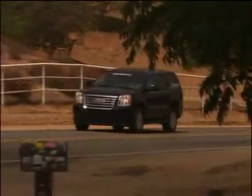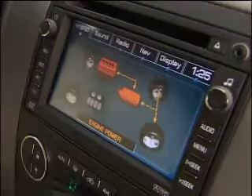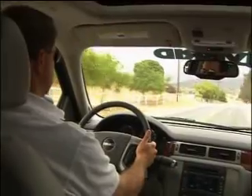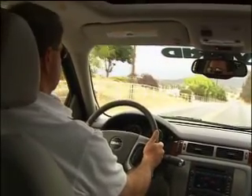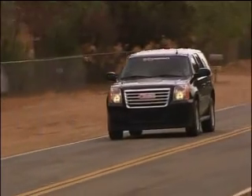This silent pull-away is the first mode. Mode 2 happens at highway speeds. The electric motors provide enough assist to keep the V8 in its more efficient four-cylinder operation twice as long. At these speeds, Toyota's Synergy Drive largely defaults to gas-only operation.